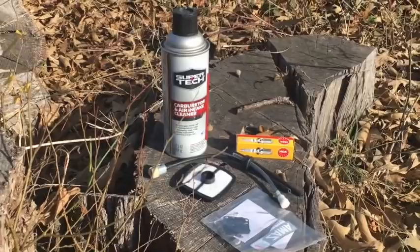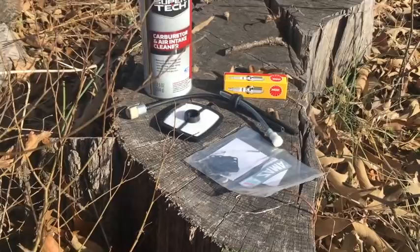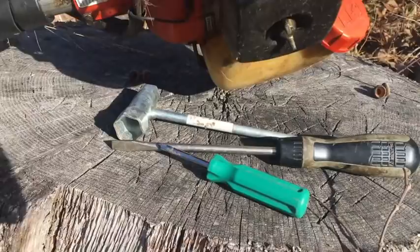To do this project you're going to want to go to your local lawnmower shop and get a few things: a spark plug, an air filter, a carburetor kit, and the fuel line assembly which comes with your fuel filter and your tank vent already attached — it's pretty awesome. If not, you can buy it in pieces and put it together yourself. You'll definitely need some carburetor cleaner, a spark plug tool, probably a flathead, and a Phillips.